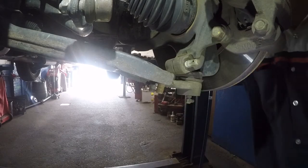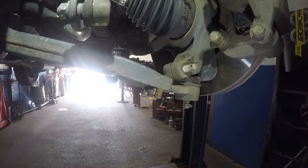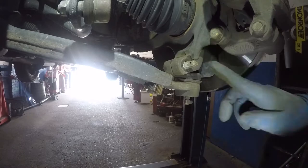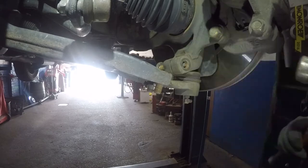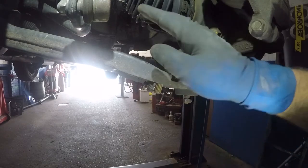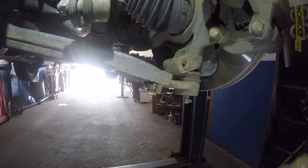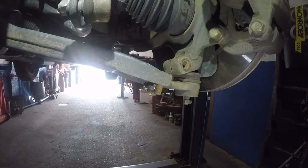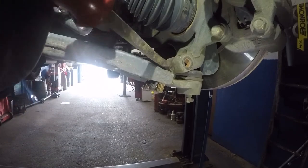That's a nice little mechanism. Sometimes it's crushing it — this is good. Next we're going to get a screwdriver. You can hit it, but if you don't have that little angle right there, try not to hit it because you'll damage the threads. Once it goes through, just take your screwdriver and hammer it and the bolt falls right out. And now if I hit this with the hammer it should slowly just come right out. See the little groove right here — you can put a pry bar in there. You take this little pry bar and you just hammer it right there.